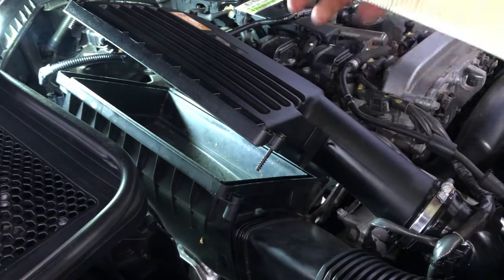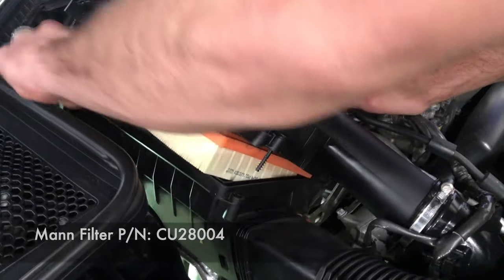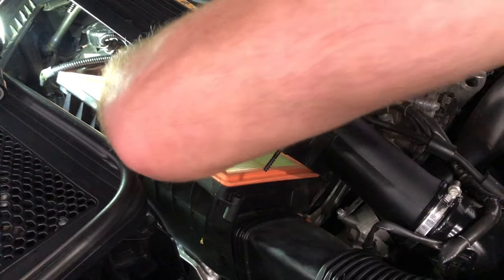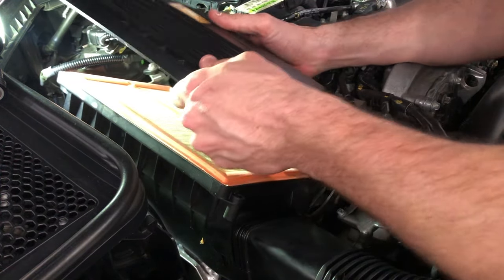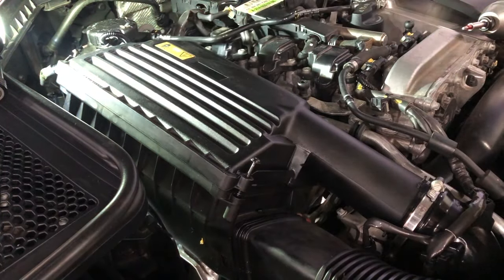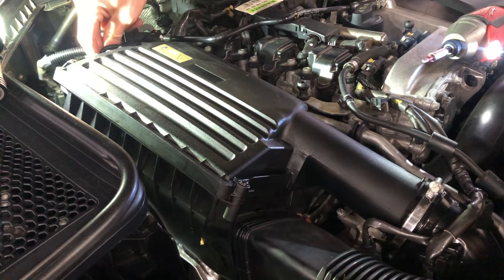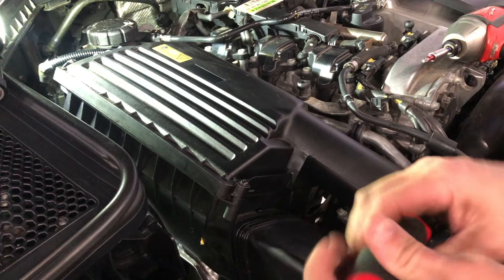This is our brand new filter. The part number is C28004. We're going to go ahead and reinstall it — just pry up the box enough to slide it down into its spot. As you can see, it fits nice and snug. We'll peel it back down into the tabs on the engine side. Go ahead and tighten up the T25 fasteners, remember to put the sensor back on — boom, just like that — and tighten up the band clamp. That's it for the engine air filter. Piece of cake.